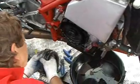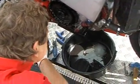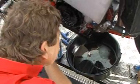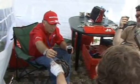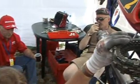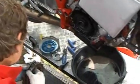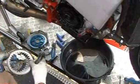Back in the awning, Chris had already pulled the 450 down to discover that several of the clutch plates were quite badly distorted, and two of them were bent way, way out of tolerance, completely destroyed really, and that's what was causing the dragging of the clutch. That's right, Chris, and they're all knackered.